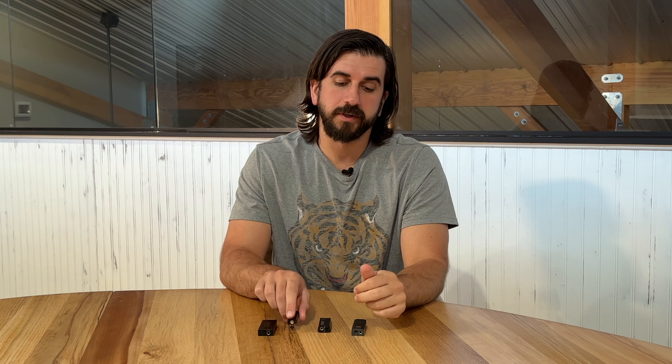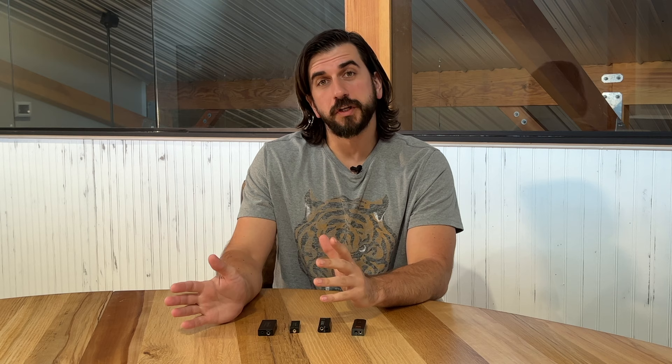From a performance and power perspective, all four of these are going to be in the same range when you're talking about the 3.5 millimeter output. They're all basically going to be able to drive most consumer type headphones and higher sensitivity over-ear headphones. These three handle IEMs slightly better without the iEMatch than the Go Bar, but with iEMatch on, the Go Bar matches up. With the ones that have the 4.4 — the M15, DC06, and Go Bar — you are going to be able to dip into some more powerful headphones, though they're still not going to be fully powered. Once you get up to something like a Dan Clark Aeon series, you're really not getting enough power even out of the balanced output.